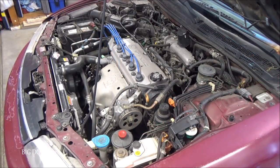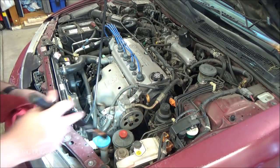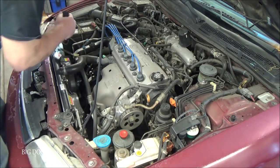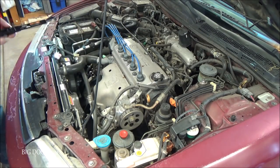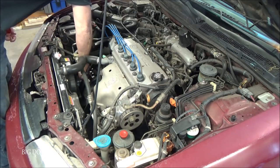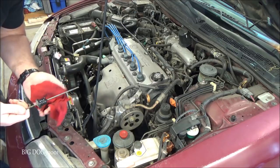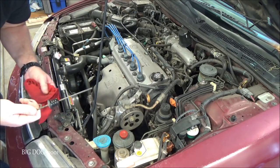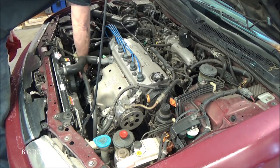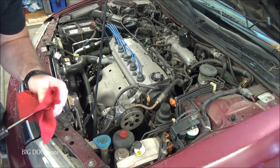We're going to start the vehicle and let it run three minutes, then shut it off for about five minutes and recheck the level to make sure it's good to go. While we're waiting, this is a good time to check our fluid levels — check our power steering, brake fluid, coolant, and transmission fluid. For the transmission, if you've seen my transmission videos, you know you've got to wait 60 to 90 seconds after the vehicle's been turned off and the vehicle needs to be fully warmed up — we're close but not exact. Our fluid level looks good though.